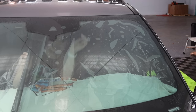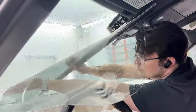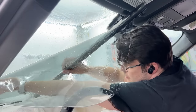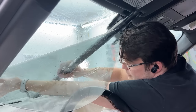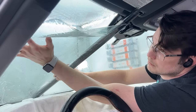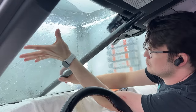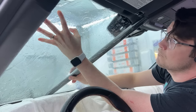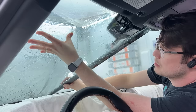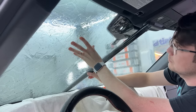I'm going to flip to the inside of the car and show you exactly what happens from a different perspective. I unroll some film — probably about a full foot — holding it with one hand. You can see the film up towards the liner; you want to get this as far down as you possibly can before you get too far with your unrolling. You could tape that upward area, but you just want to make sure it gets lined up because it makes for as clean an installation as possible. Once it's tucked down into that lower corner, I start unrolling with my other hand — the act of it being rolled up like a tube helps support it through most of the unrolling process. This was a hard thing to film while actually installing, so over on the passenger side I show the rest of it — I pulled the liner out a little bit early there.